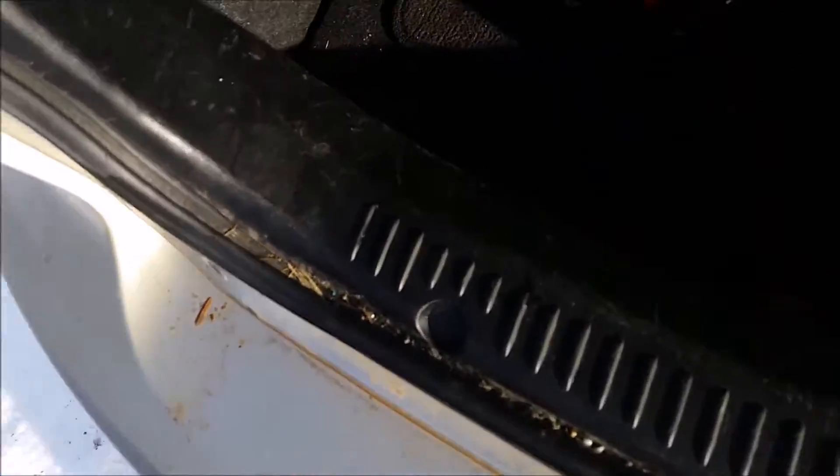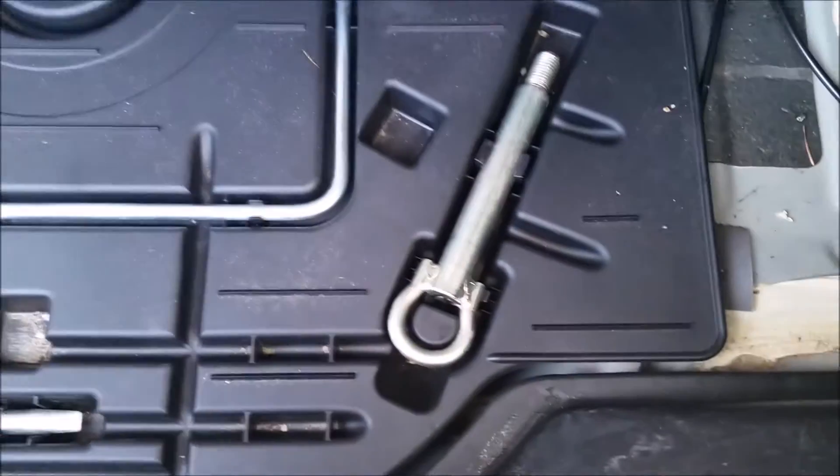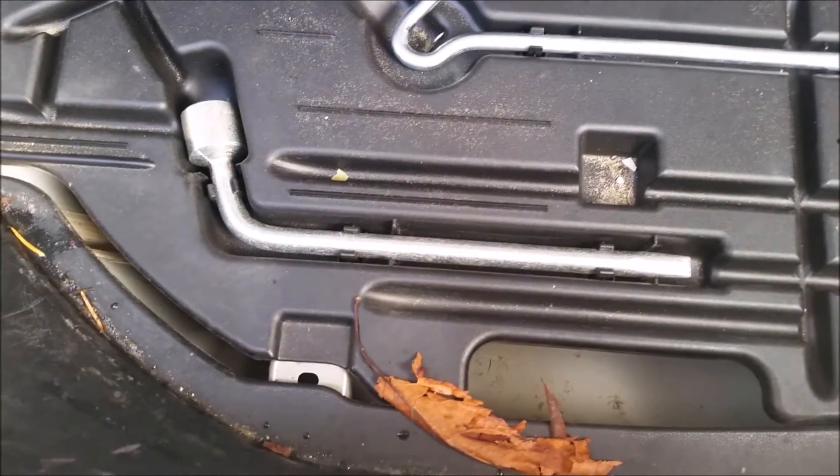You've got to go to the back of your car. This video isn't great, but you can see — look into where your spare tire stuff is and your tire changing gear. That's your tow hook. It's got some threads on it. It looks a bit like a tow hook, I guess. And that's your tire iron. You need that to help pop out the little nub and twist it. So grab these two.